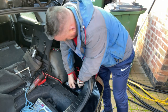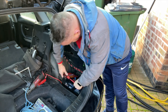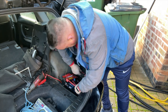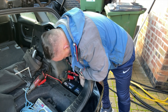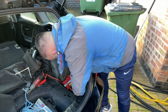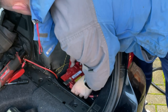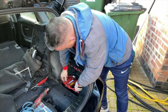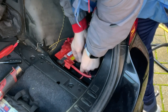Okay, that's in there. It's located in that end - so far so good. Nothing's trapped. We'll get the negative terminal down and pop that on, and the positive - drop that on as well, then clip that down by just pushing it down and it clips itself in. We've got this wire that we disconnected - feed that back under there and pop that in as well.